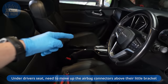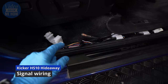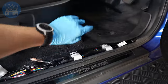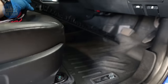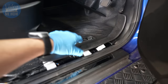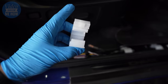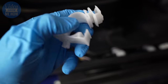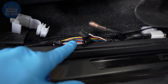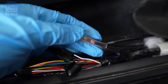We're going to put one sub under both front seats. If you're installing into a 2021-plus D-Max, here's what you need to do. There's a little trim piece — just pull your mat out of the way, and it will pull straight off. You can see there are little clips on the top and bottom that just pull straight up and out. Then there are little clips you can access the loom through. I recommend doing it on the back one. There's a whole bunch of wires here including some really unusual connections — let me know in the comments if you know what those are.